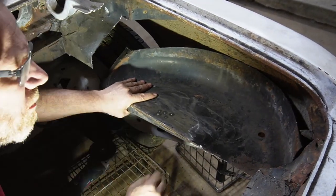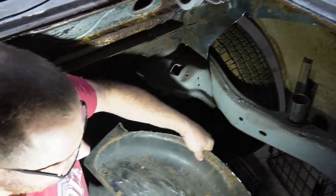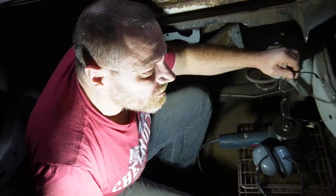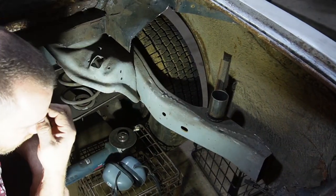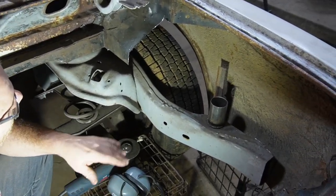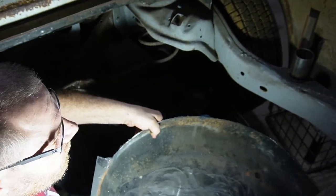This is going to end up sitting down here more and then we'll fill these gaps — we'll do some blending and extend this down an entire stanchion. We'll have to rebuild some of this area. I can't get over how solid this thing actually is in some areas where you'd expect it to just be completely rusted out — and it's not. We'll do something for these body braces, rotate them and put a brace in here to keep the shell from flexing in the wind, keeping it pretty much unmolested. We won't need to build a wheel well and we can still get airflow through here — the trunk will stay clean and out of the weather.